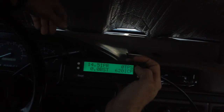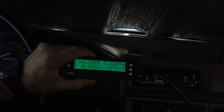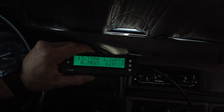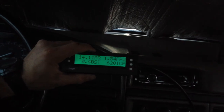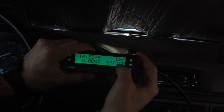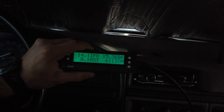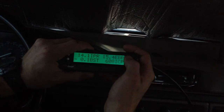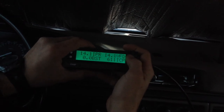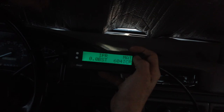I'm still able to get the RPM and things of that sort. Of all the X-Gauges I have, I've got fuel pulse width — that's basically telling me the period of time the injector is commanded to be open, measured in milliseconds, and it varies based on load. I have the MFD, which is mass fuel desired. I have EBP, which is exhaust back pressure — that'd be good to see if your exhaust back pressure vane is sticking. And then there's volume fuel desired, which I want to say is in milligrams per stroke.